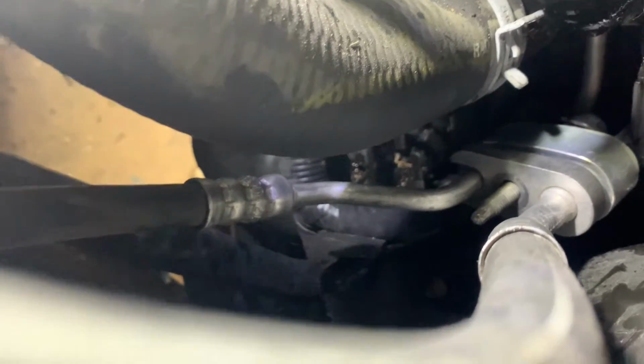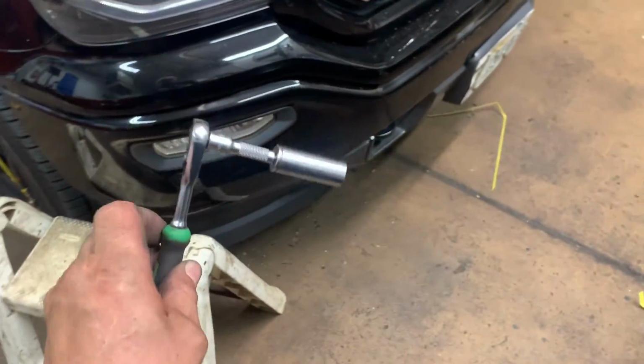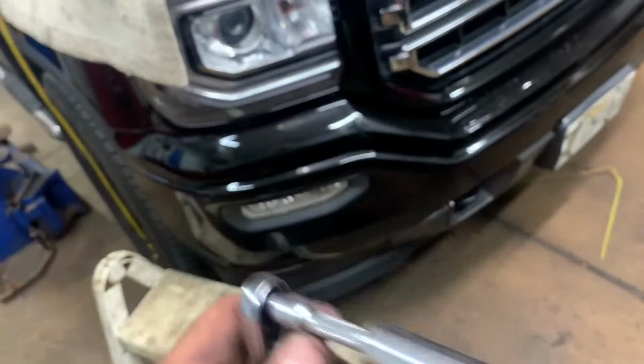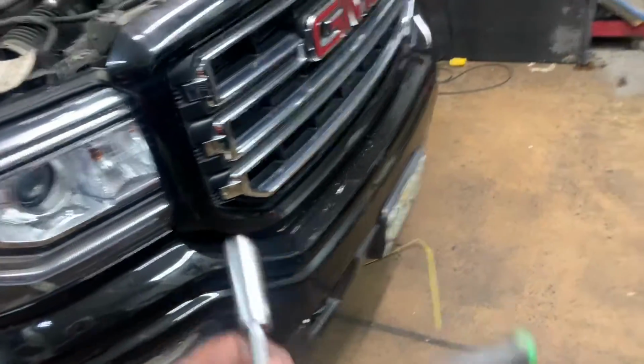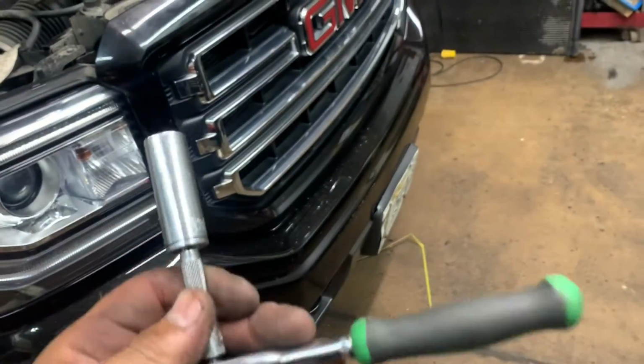Now what you need to do is put the nut on it and tighten the nut up. Okay, you got that nut tightened for that condenser. I just used a 1/4-inch ratchet and a short extension and 13 deep. Tightened it up. I didn't bear down on it, it's only aluminum. It might equal maybe 8 foot-pounds about, but just be careful, you don't want to over tighten it.